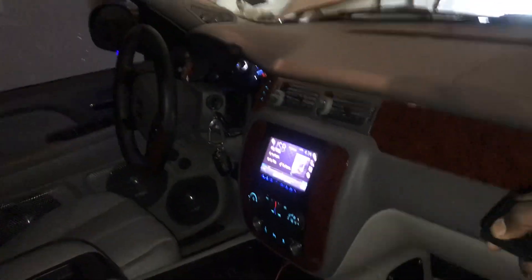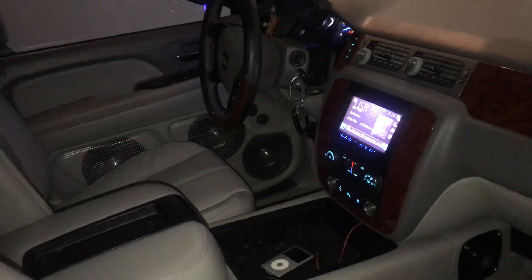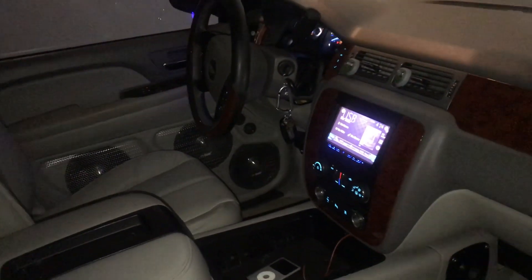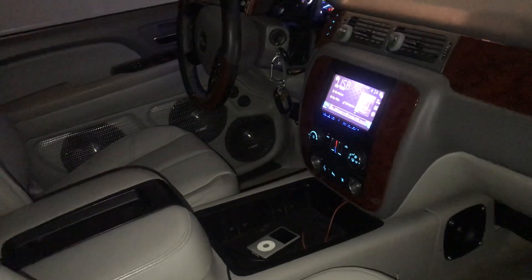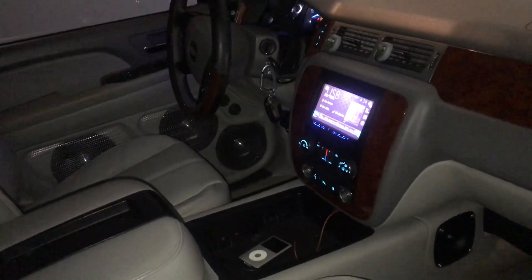So as y'all see, just with that left amp — and that's for that left door right there — I'm seeing about 500 watts. I think that was the peak I've seen. So when you guys have your two-channel amps and you're getting that exact RMS and you're trying to play music, you're not getting all the power that you think you're getting. That's the reason why I get bigger amplifiers, like a 3,500 on each door, so I can have more output from that amplifier. If you get something small, you're going to get small output.